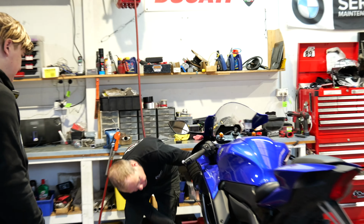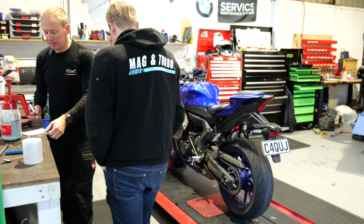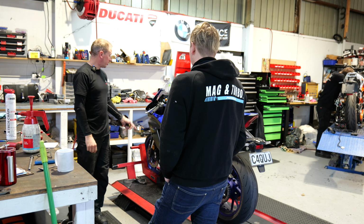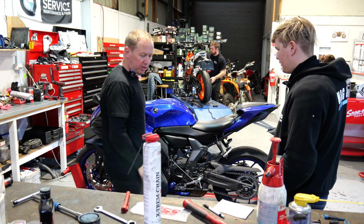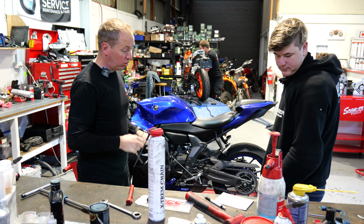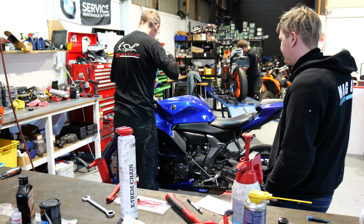And then we got here. All right, so you've already got all your sag without you even sitting on it. So there's 25 mil of static sag in this fork. I mean, you can see it's huge. Yeah. So we're gonna do some pretty big adjustments on that, and I'm gonna adjust the fork before I even sit you on it because it's so far out. Otherwise, we're just gonna be off.